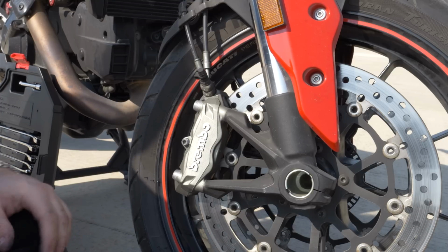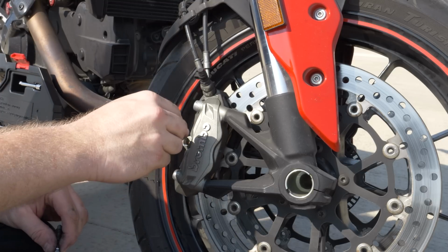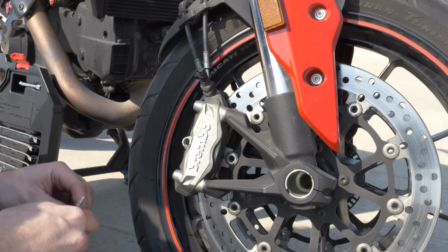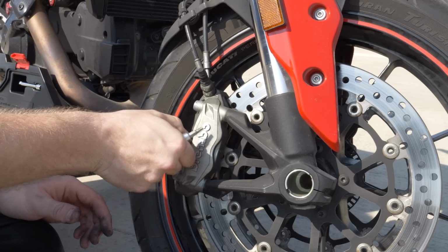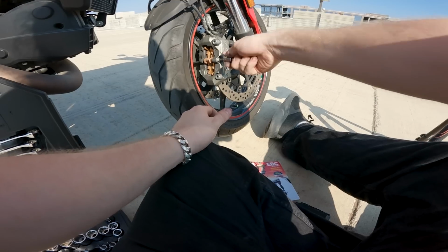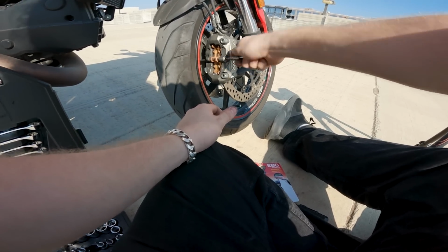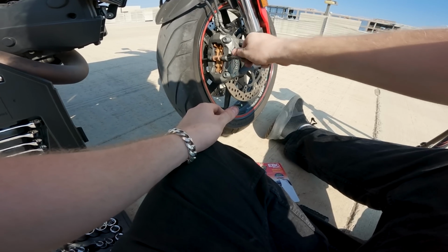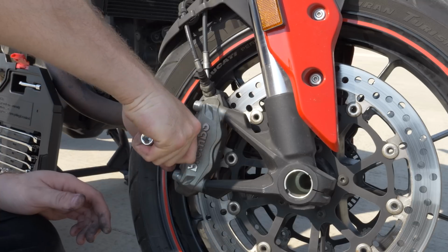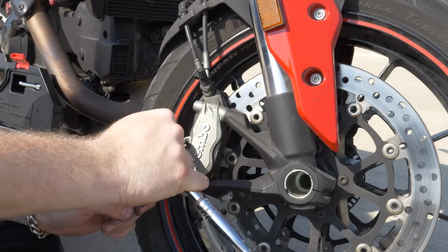So if you're at home working on your bike, one thing I would recommend is make sure that if you're gonna start running a tool or a bolt in, make sure that you start it by threading super lightly, not actually with a wrench. This is just like using it like a screwdriver. That makes sure that you're actually going to find the right spot and it's gonna sit properly. And then you can actually, you know, torque it down.